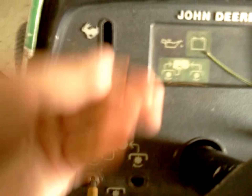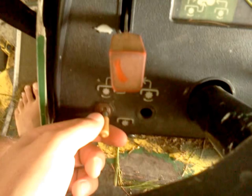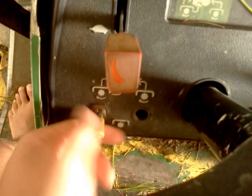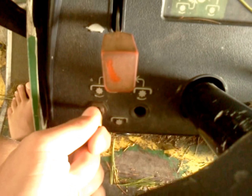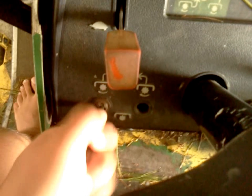Here's your throttle — slow and fast. The 318 had a variety of options available, and as you can see there are two switches here. This switch is for the power takeoff. It's a horizontal shaft engine, so the power takeoff is driven out the front. It's driven with a mule drive down at the bottom there. The mule drive twists the deck drive belt and turns the deck.